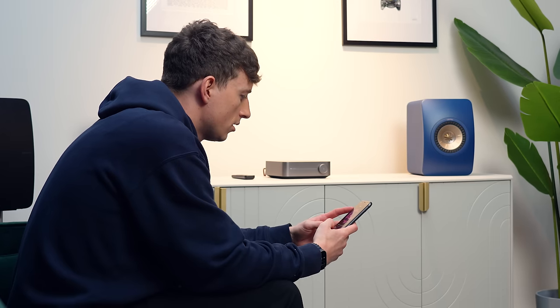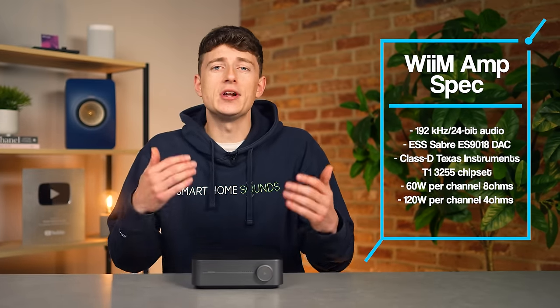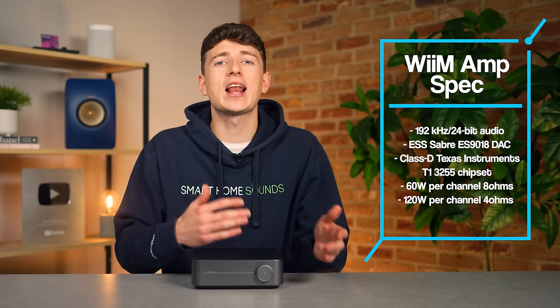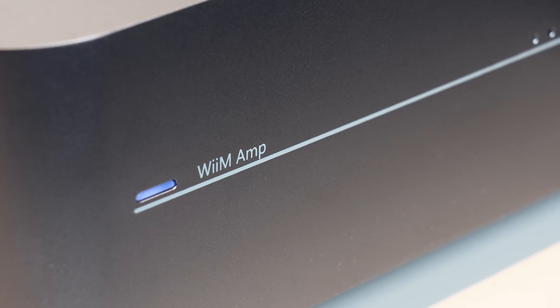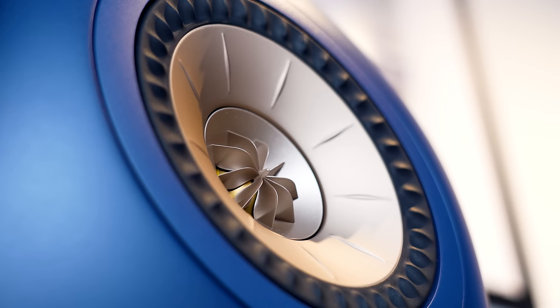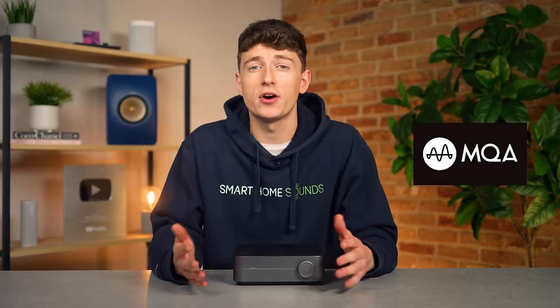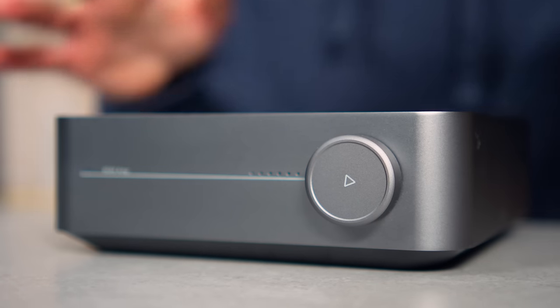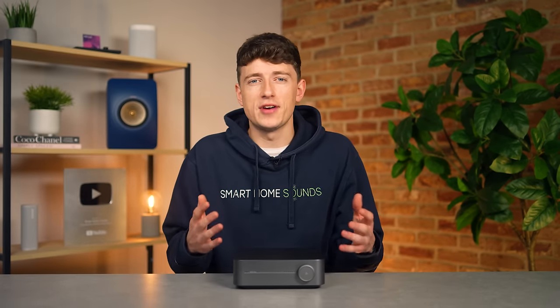I've never been one to judge a product purely on spec sheets, always opting for a combined, more realistic real-world testing. But in terms of the tech inside, just like the WiiM Pro Plus this amp supports up to 192kHz 24-bit audio. There's an ESS Sabre ES9018 DAC, which is a favourite among audiophiles, and thanks to the Class D Texas Instruments TPA3255 chipset, this one is capable of outputting either 60 watts per channel at 8 ohms or 120 watts per channel at 4 ohms. The WiiM Amp can handle almost all lossless high-res audio content and is MQA compatible. The only thing really missing for out-and-out audiophiles is DSD functionality — a bit odd considering the DAC can actually handle it up to 11.2MHz, but it's just something to bear in mind.